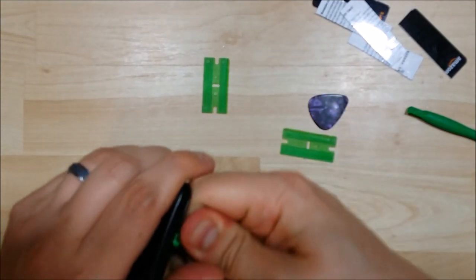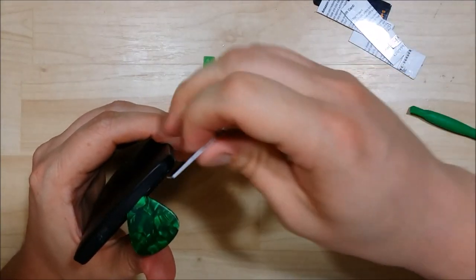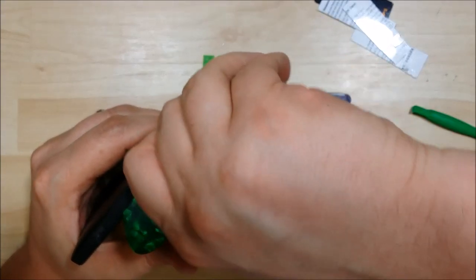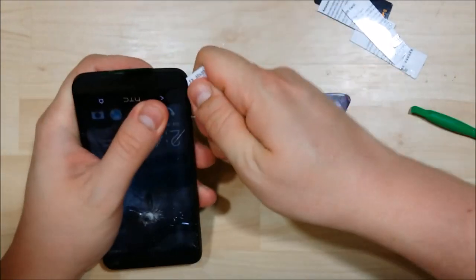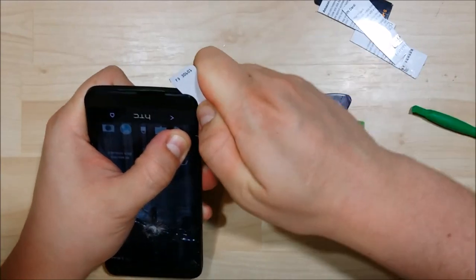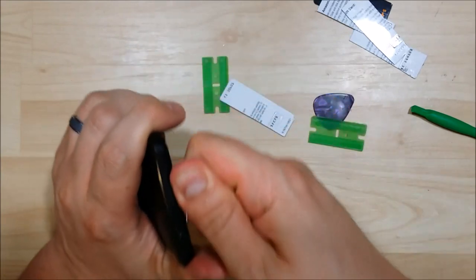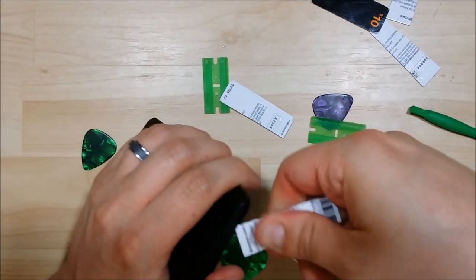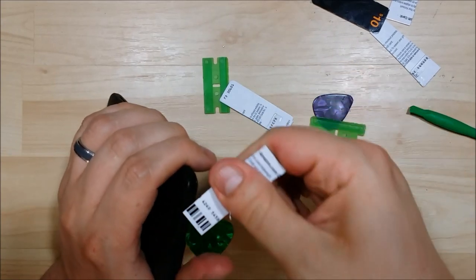Let's start down here at the bottom — the bottom seems like the place to go. I got a lot better separation down here, so maybe starting at the bottom would be the best way to do it. I am using some plastic cut-up gift card to see if I can get it in there. I know there is a connector right here on this corner, but I am really having a tough time getting any separation between the housing and the side. Normally it would just clip off on a lot of other phones, but this M7 is put together so tight that it is really, really difficult to separate.